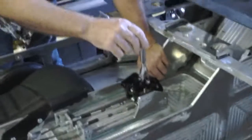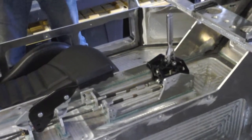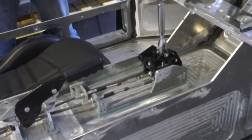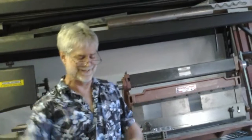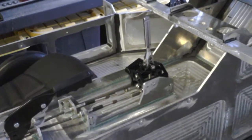The shifter. This is a numeric brand shifter that they modify for me for this type of car use. It's a Porsche competition shifter, but the Porsche shifter has a great big foot on it, and it makes it stick way up. If you used it in stock form, you'd look like one of those Rat Fink models, you know, when the shifter's way up here like this. So they modify it and bring it down. These are Morse cables, Cablecraft, anybody's got those, but we'll go into that more later, but let me show you back here.